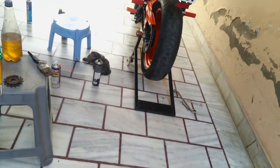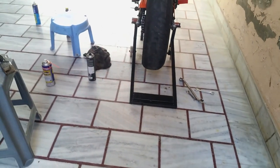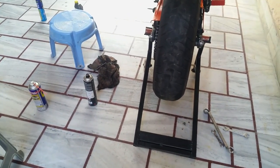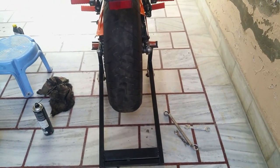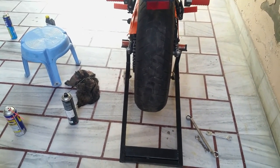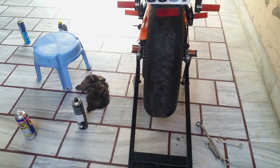So it kind of looks cool, actually. It looks big. This is the maximum wide tire you can install in the KTM RC390, 160mm, 70% profile. I've also tried 180mm, 55% profiles, but they don't look as big as this one because with a 55% profile, your alloy tightens them up. But this is a 70% profile.